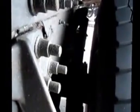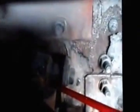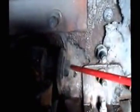are in place, not cracked or broken. Okay. And there's no shiny spots on my springs to indicate a loose U-bolt. Alright, now to finish up the suspension, I'm going to talk about my shock absorber. Make sure it's not cracked, bent, or broken. It's not leaking, and there are no missing bolts.